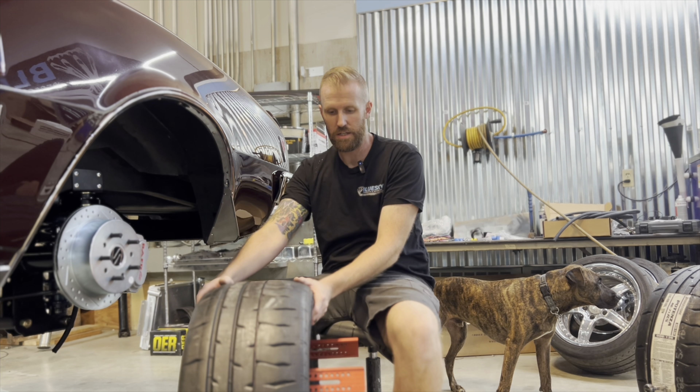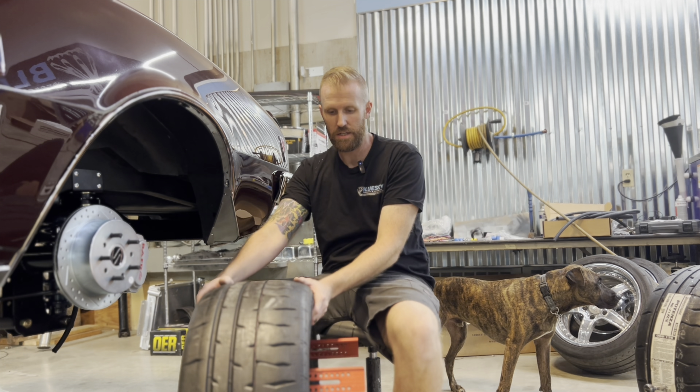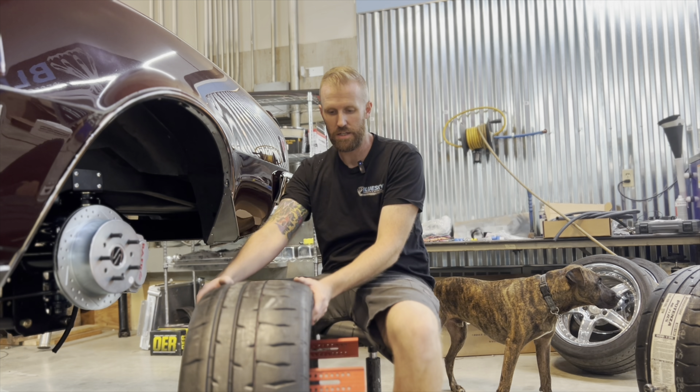It's a good-looking wheel — nothing beats a ForgeLine. That concludes the wheel fitment video. Again: invest in tools that make your job a lot easier, take your time, double-check, and take the time to take the coilovers out — it may seem like a big pain, however it'll save you a lot of money in the end. Joe's Firebird — one of our quintessential builds here, really iconic local car for us — is now that much better with a set of properly fit ForgeLine wheels on a Roadster Shop spec chassis.